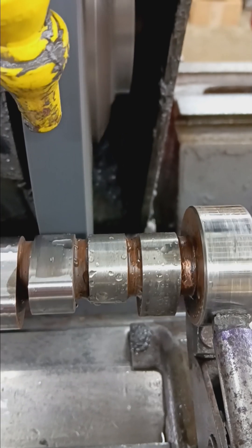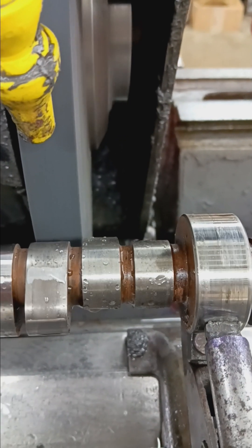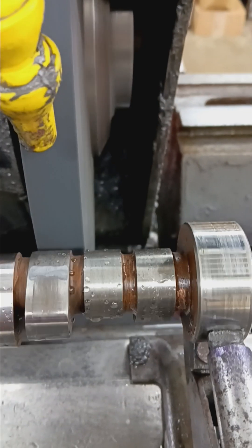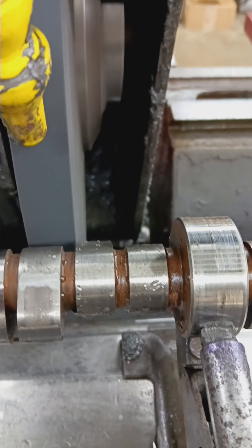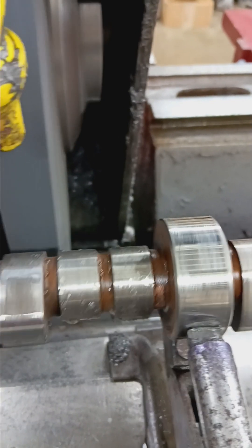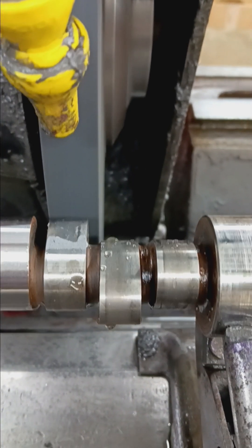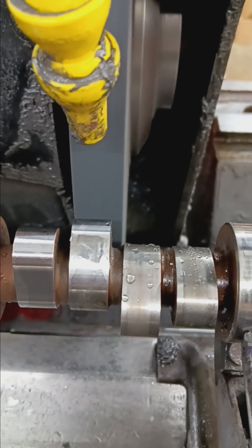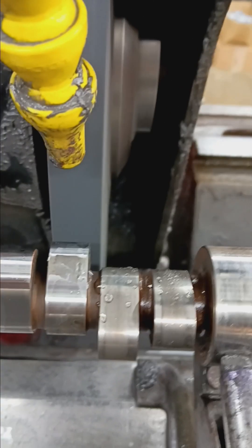Right off the base circle and over the nose has cleaned up, and then all this area here is low, probably from lofting — the valve train is out of control as it comes across the nose.